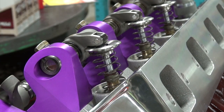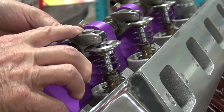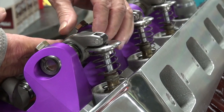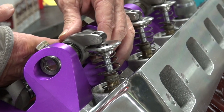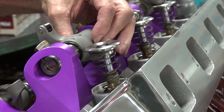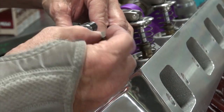Our next little problem on our mock-up: you hear that ting? That's not hitting the valve - watch right here, it's hitting the retainer. Then you hear that ting of it hitting the valve. What are we going to do about that? Some people might just clearance it here, and that'll probably work, but I'm not willing to do that. Probably the easiest way out would be to run lash caps.